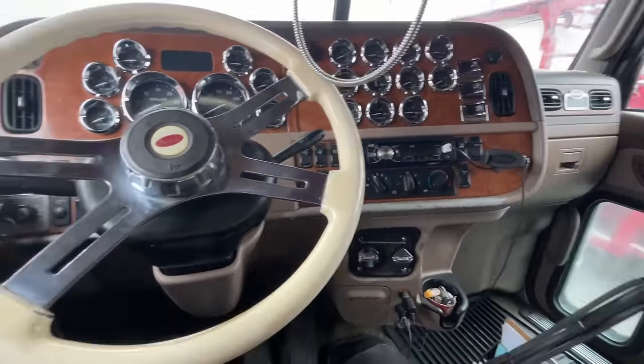So downshifting with the transport truck is a little more interesting because the transmission is not synchronized. So you have to double clutch and rev match at the same time you're dropping gears. Say you're in your last gear and you need to shift to seventh. So you're coming down, you're on the brakes, you're slowing down, and you let off the brake, clutch in, neutral, clutch out, rev, clutch back in into the next gear down, and clutch out and brake.